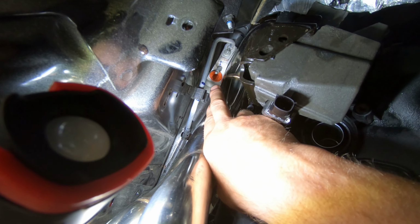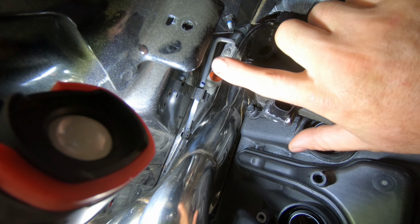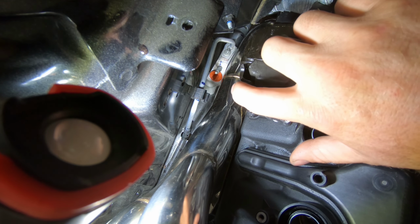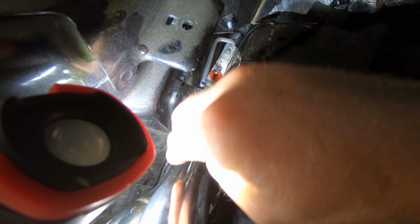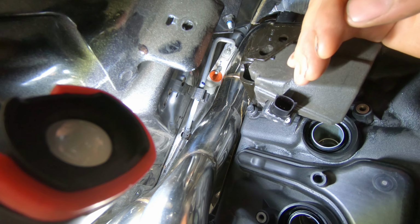Looking at that AC block there, the wiring harness was on that side of the AC block, running right along here. Now, with the wiring harness there, this AC block was pushed this direction. Because it was pushed this direction, it was against the manifold really badly. And it also shifted the engine over a little bit because it had so much pressure against it.